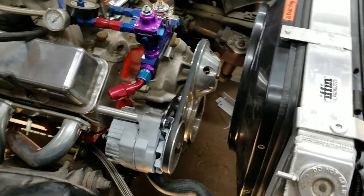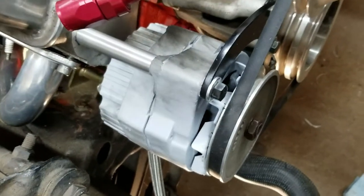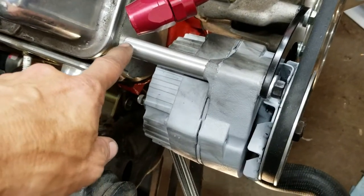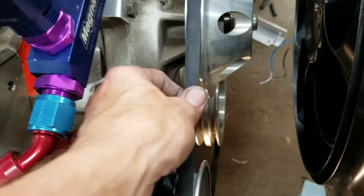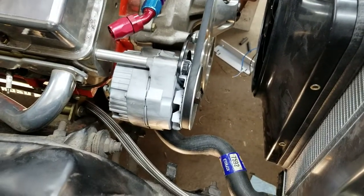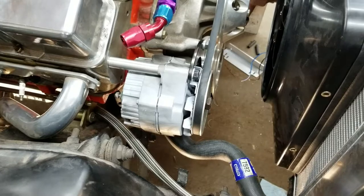The alternator's painted and done. The bolt in the front — the top one — that's the one I made, all done and painted. I like that smoke from the burn flames, it's kind of unique, kind of cool. Everything's all bolted in. I put anti-seize on all the bolts going into the aluminum, and the belt is relatively tight. That bottom bolt is a bear to get to because the belt's right there, so that's gonna be a fun one. That's about it — one more thing done, crossed off the list.